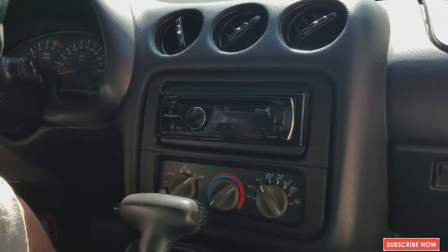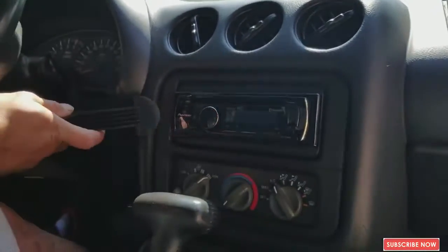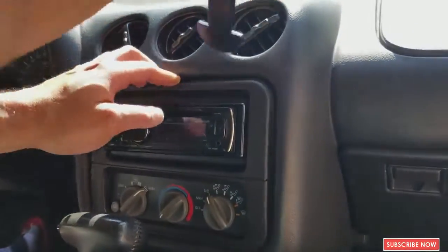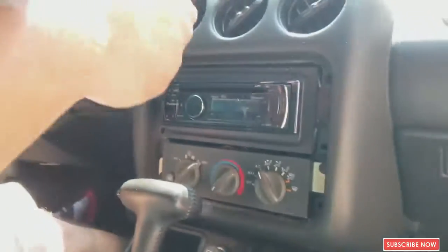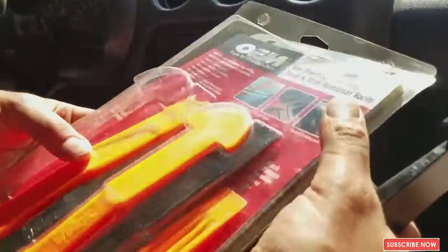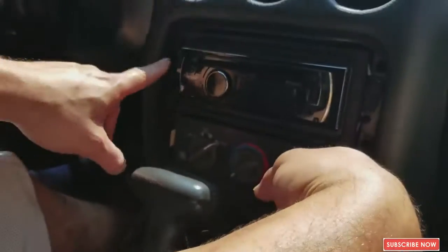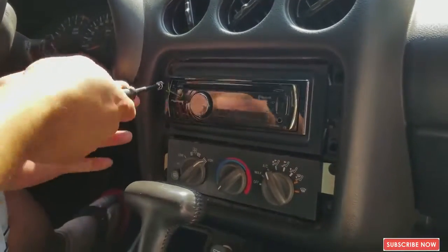Okay guys, so we're gonna take the old radio, and the way to do it is, you will need this plastic pliers so you can pry this plastic out. As you can see, it's easy to do with this plastic tool. You can buy it at any auto parts store, or I'm gonna leave a link in the description so you can buy one. And after you do that, we're gonna take the screws, the 4 screws holding the radio. There's 1, 2, 3, and 4. So I gotta take those screws out. Okay, so we're gonna proceed to take those screws out.